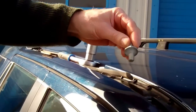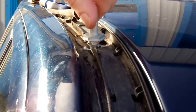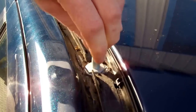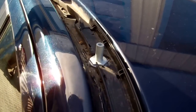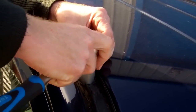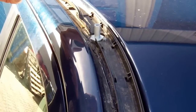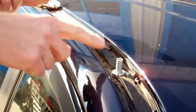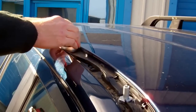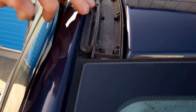Dab some silicone around the fitting so as it goes in it will form a seal, then wipe any excess off. Be careful not to cross thread it - it should spin in pretty much by hand. You can see why you need the long reach socket: you could get the old one out without it, but this new fitting stands up and that's where the spark plug spanner socket is essential. We'll tidy up and put the rubber seal back in.